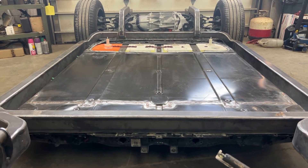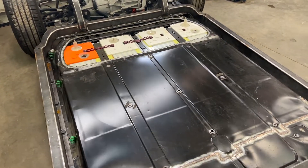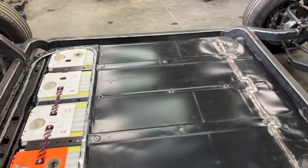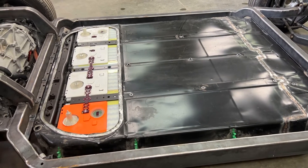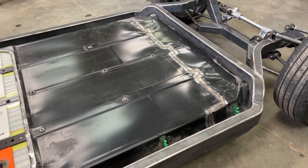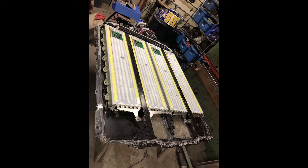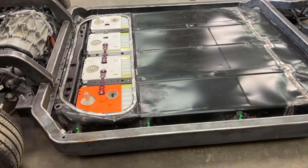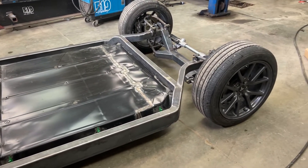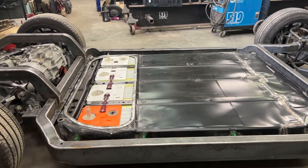I'm using a chopped-down Model 3 battery in this. This battery is a 50 kilowatt pack. The early Model 3 standard range pack was a 50 kilowatt pack — Tesla supplied those with short modules, so the case form factor was the same but the modules inside were a little bit shorter. What I was able to do is take the modules out, strip it down completely, cut 16 inches out of the battery pack, redo some of the cooling system, and package it all back together. That allowed me to get a wheelbase of 98 inches — about as short as I can possibly make these chassis using a floor-mounted battery like this.